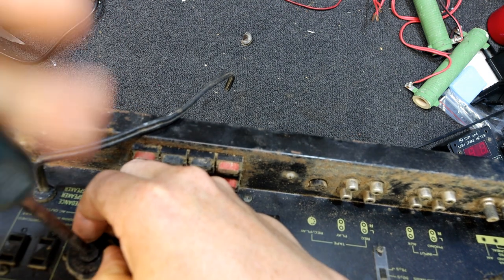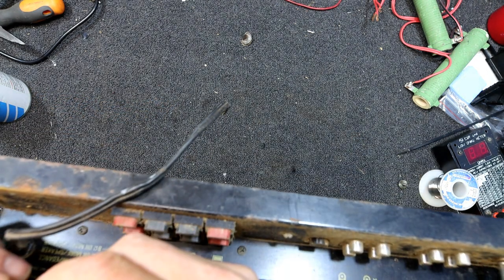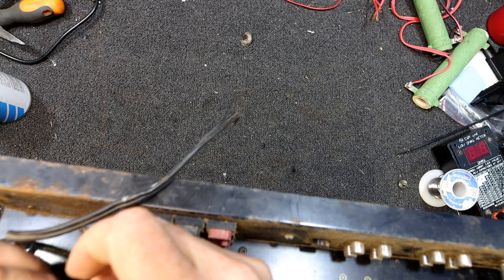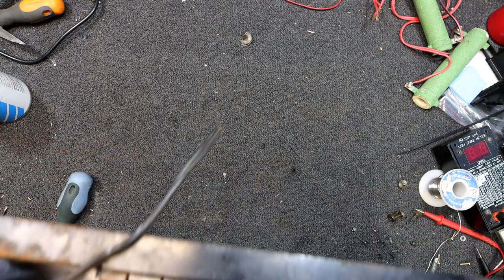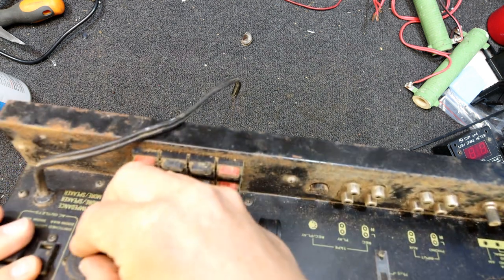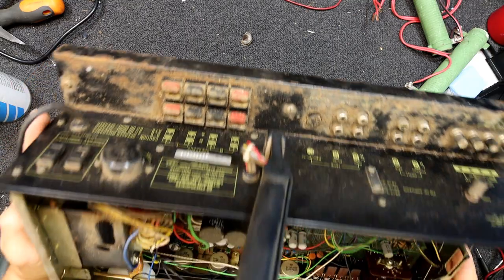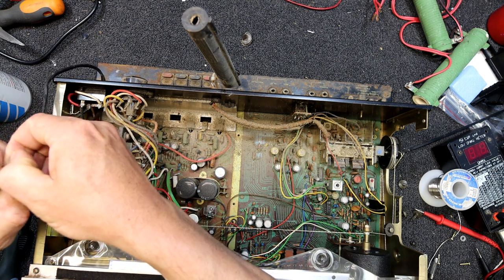We don't want to get 240 volts from it if it's looking all corroded. It's often best to check no one's done anything dodgy with it. I should really check it's the right rating — you never know what people have played with. It's 1.5 amp for 240 volt, and we're in the 240 volt position. That's your voltage selector — you just point it with this little cut-out to the voltage you want. So we've got 240 showing there. I should do that with every amp, especially when the fuses are accessible from the back, to make sure they've got the right ones in and someone hasn't put a 30 amp car fuse in there.